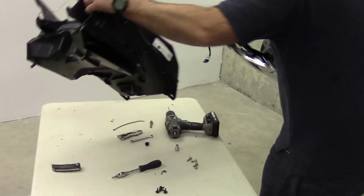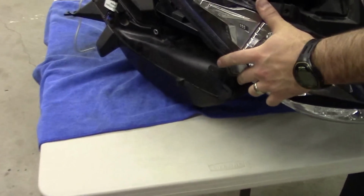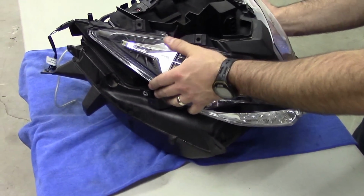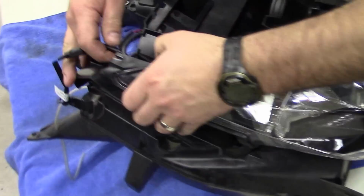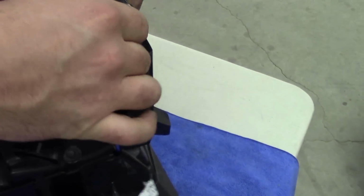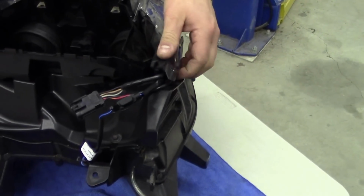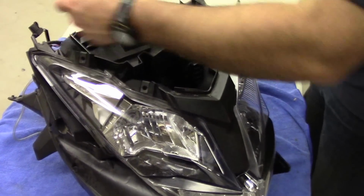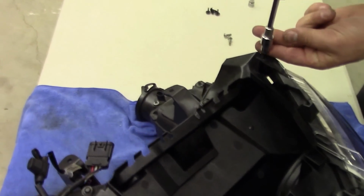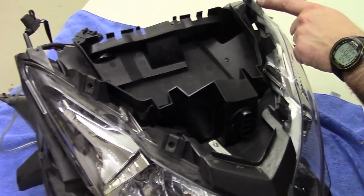And we're going to place this assembly back onto your airbox. Again, sliding it backwards into place. You'll see that your wires have to go around the back side of that post. Then this is all ready to go into place. Just making sure that none of them are getting pinched. It looks good. Get your top two 8mm self-tappers in. Again, these are just going to be snug because it's easy to cross thread or strip plastic out, and we don't want to do that.